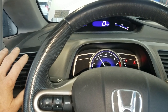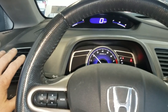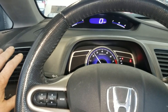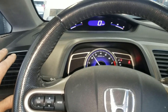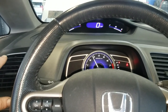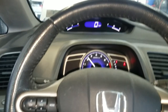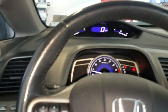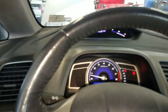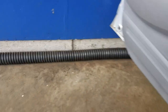Basically, I got this motor hot. AC was applied, there was 13 volts at that connector, and the clutch was not engaged. All I had to do was use a long pry bar and actually tap on the front of that clutch assembly, and it pulled in — definitely showing that it needs an AC compressor clutch. But let's take another look here.